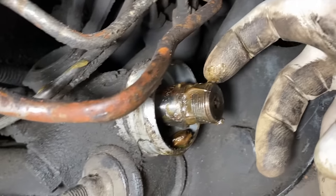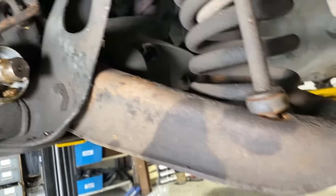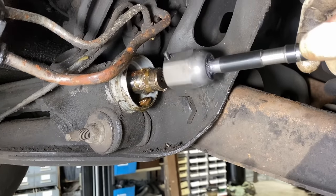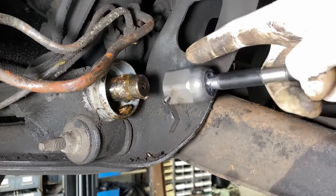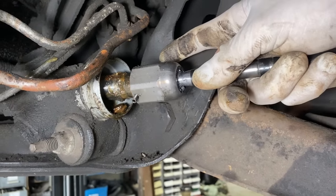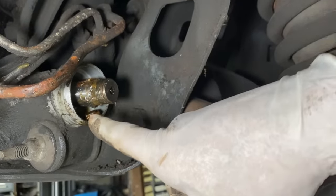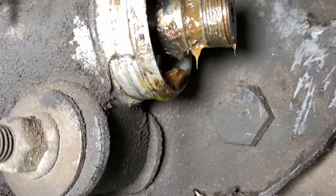I would rub the grease off these threads and then use some brake clean on them. Put some red Loctite or blue Loctite, it's fine too, on these threads and thread it on all the way down. Snug it down pretty hard with a wrench. Once it's snugged all the way down, hopefully you'll still be able to access these and you can tighten these down too. I would put a dab of blue Loctite on those threads too, and those just kind of get recessed into this little groove here as like a secondary, it seems.